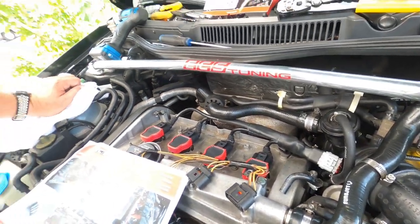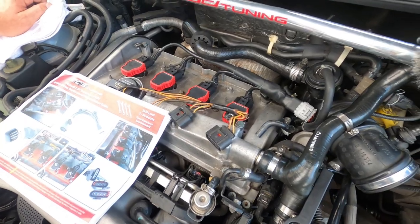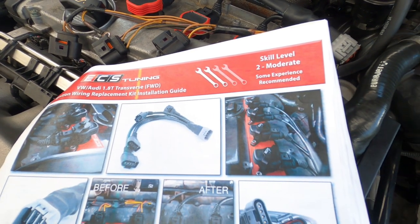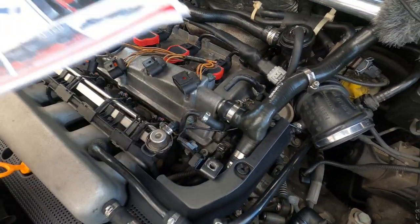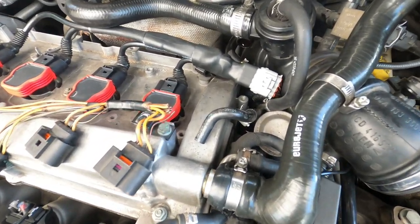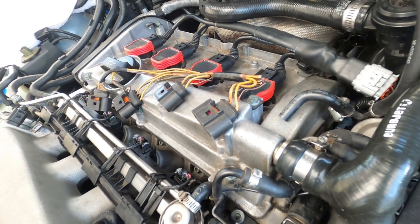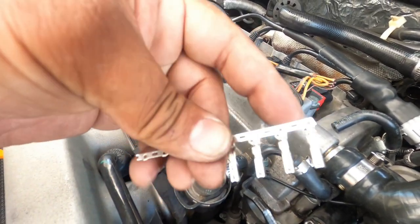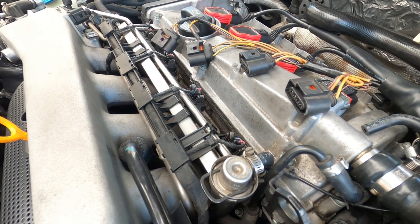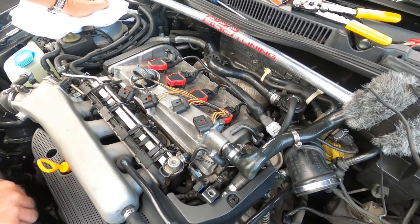Thanks for watching this episode of Peachy House Garage with Rob and me doing the job here. It's not that hard - at a Peachy House Garage skill level, anyone can do this with basic hand tools and wire crimping. The guide they provide works really well. Just take your time properly stripping your wires, crimping them, and using solder as a holder to keep the wiring in place. If you don't solder them it's going to cause premature failures. We soldered right in the middle between the two crimping points. Thanks for watching and have a wonderful day. Peace out, much love.